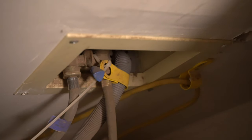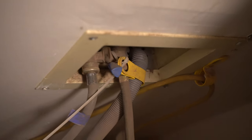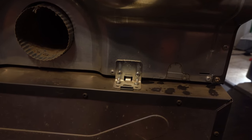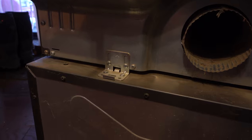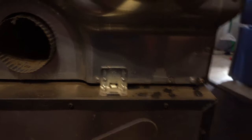I'm going to kill the power on the fuse box and go ahead and shut the water off right there. You're also going to need a good set of channel lock pliers in order to disconnect the hot and cold water feeds at the back of the washer and dryer. This is going to be similar to how this connects up when I stack it on top of the dryer — these are the connectors they used for the pedestal.